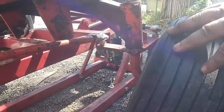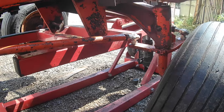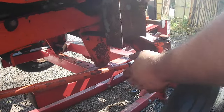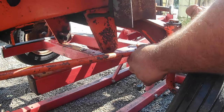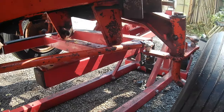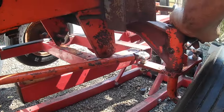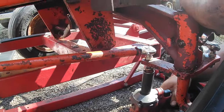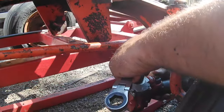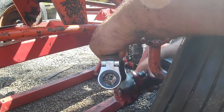Okay. And then now we're just gonna lube the threads a little bit. Lock washer. Jam nut. Get it started. And then you're gonna tighten it up. Impact makes this job a lot easier, but you can use hand tools. 5/8 wrench on the top of the shank. You don't have to go crazy, but just snug them up nice. Okay.